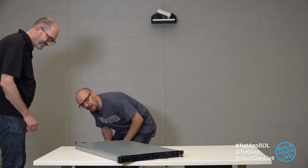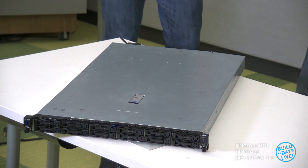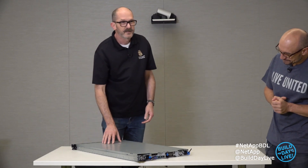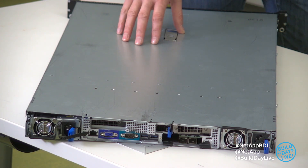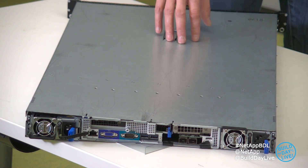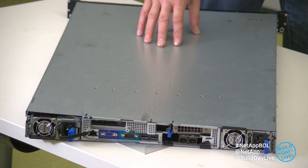In this case, what we have is a storage node — this is the first time we've got it out of the box. We can tell it's a storage node through the network on the back end. On storage nodes, they come with two 10/25 gig connections for iSCSI connectivity. We also have two 1 gig ports used for in-band management, as well as an additional port for out-of-band connectivity — remote management out-of-band, plus OS direct management on 1 gig and then 10 gig for the actual storage traffic.